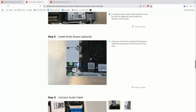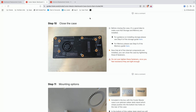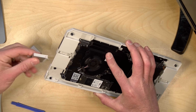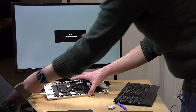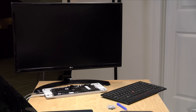According to the guide, the next steps would be to install the audio board, which we are opting out of in this project. After that it's just closing up the case and booting. So I'm going to install two of these USB modules — the USB-C ones. I'm going to use one for power and one for video. I don't have an HDMI adapter here so I'm going to attach my HDMI adapter to this and see if we can get something to boot up. I also installed the USB-A adapter so I can plug in my Lenovo wireless keyboard and trackpad.